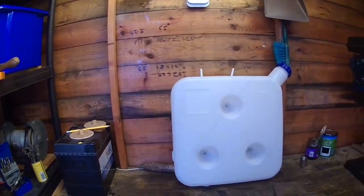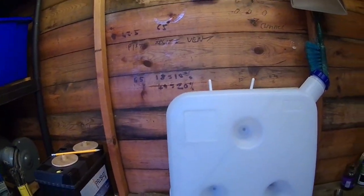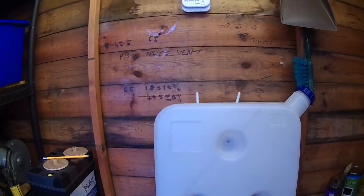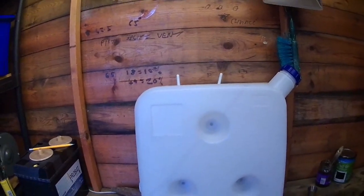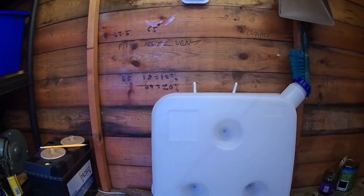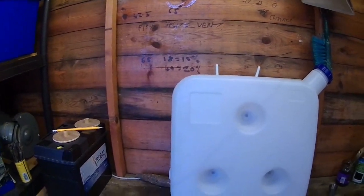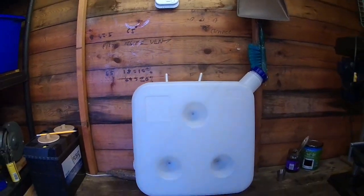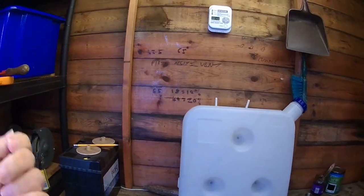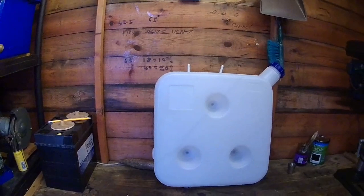Yeah, my only suggestion to people is to try and run the plastic fuel pipe underneath your van rather than inside your van, and also put your pump and your filter under your van rather than inside. So if you need to change any of that, you can do it from underneath, and any spillage of the diesel or the paraffin is not inside your van.